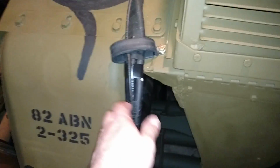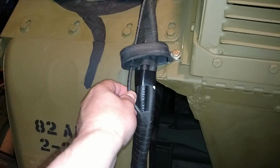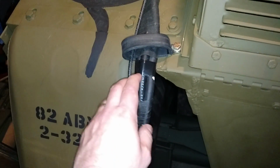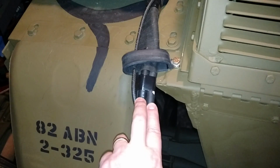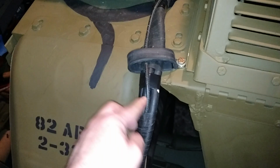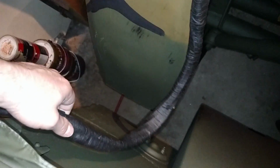Okay, so which will bring me to this tether here. So we have three large cables and one LS454 loudspeaker extension cable. So here we have two CX4723s because it's going to feed to the commander's control box and the driver's control box, and then we have that frequency changing antenna that we're running up front. So definitely want to make sure you leave plenty of slack for the articulation that you're going to experience when you go off-road. Just FYI.